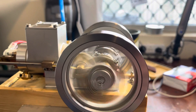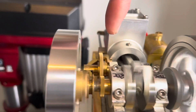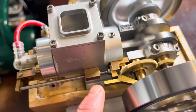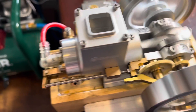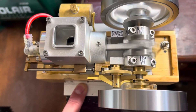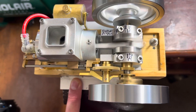So you can see — if I check the weights, I don't know if you can really see them — they expand out and you can see how the latch finger moves in and out. Maybe better from this angle — see how it catches the latch block. So then it will let go of it, close the exhaust, get through its compression cycle, build compression, fire, RPM increases, weights come out — and that's it.